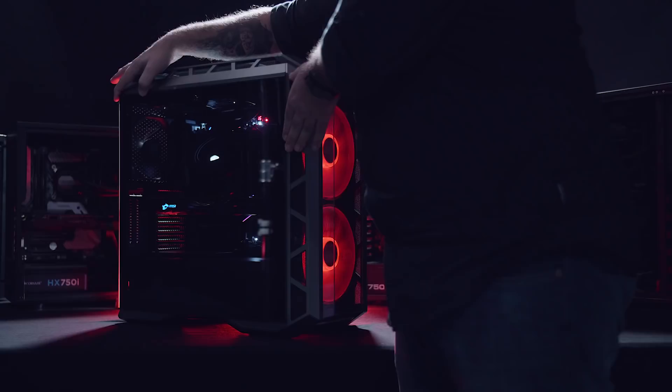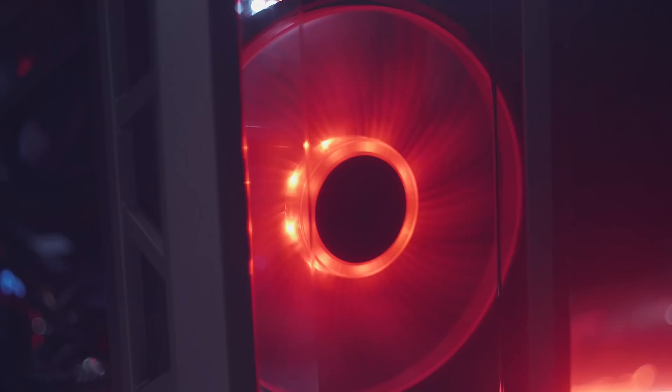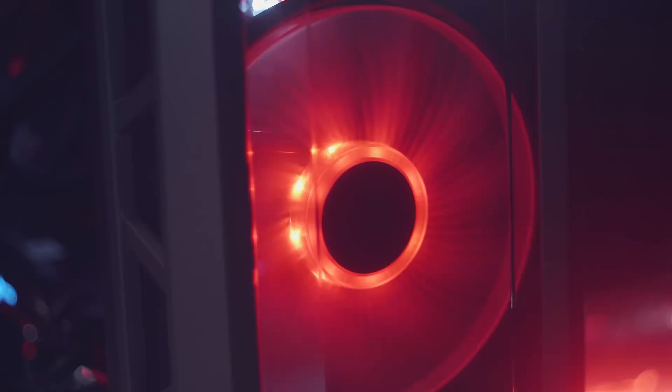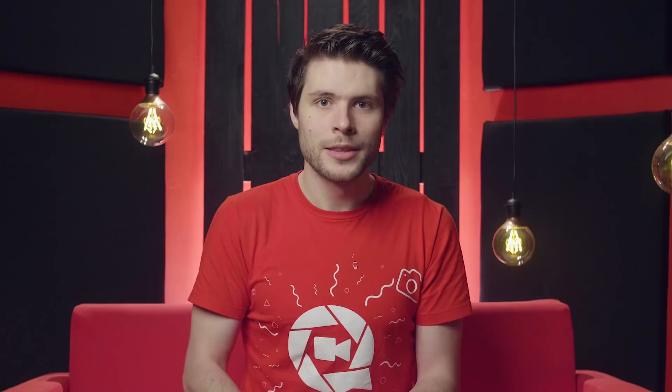Speaking of cooling, your case is an important factor here too. MSI sent us a very awesome-looking case with big LED fans on the front — which you can even change the colors of — and a glass cover on the side. This one also came from Cooler Master, but of course a fancy case will not help you get better performance. The number one reason you should choose a case is for the airflow; the second reason could be the looks. To find out if a case has good airflow, look at the fans it comes with. Ideally you want a fan on the back and on the front — one sucking air in and the other blowing it out. Only then do you have good airflow. The larger the fans are and the more you have, the better your airflow will be. Also pay attention that all your other hardware will fit in it.